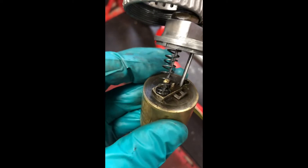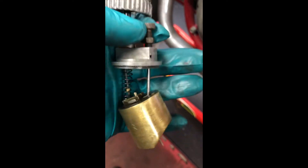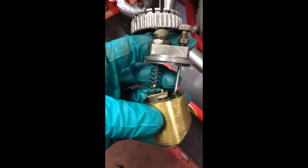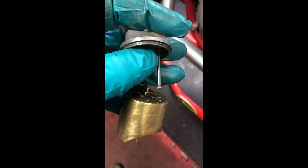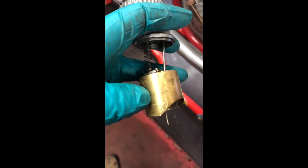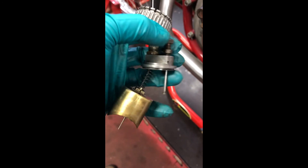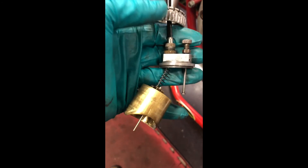If you pull that little clip out, it frees the needle up. The interesting thing to note here is that this device is in fact the slow running idle adjustment. What it does is it pulls up this pin — there's a piece at the bottom — so as you screw the part up, it actually keeps the slide a little bit higher than it may ordinarily be, which allows the slow running of the motor to be set. Some people think it's a choke, but it isn't. It's basically pulling the slide up to the minimum position for when you've got the throttle shut off.